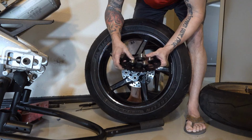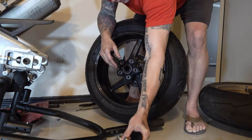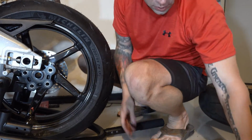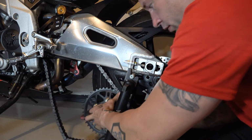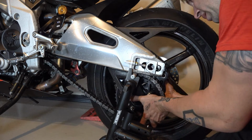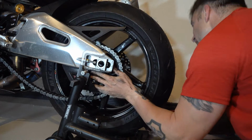And we see that this has a cush mount. That piece that goes in there, and what we'll do, put the wheel in first. I don't put that in. So I'm going to line up the brake disc properly. Okay, so that's happy. I'm going to take the sprocket carrier, put it on the chain, and then bring it up to where it fits in. There, okay. Those are in, that spacer's in there.